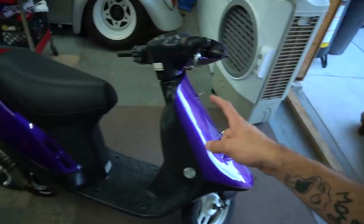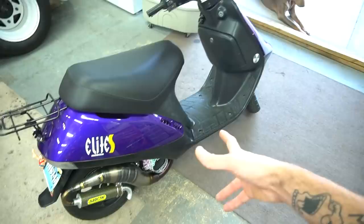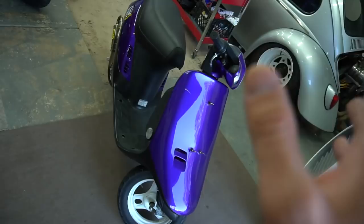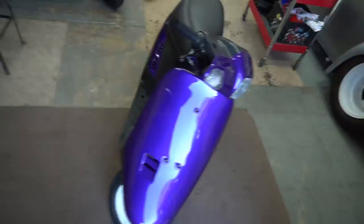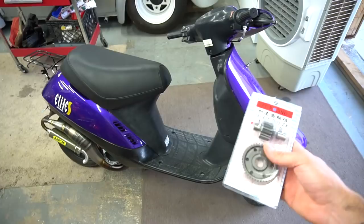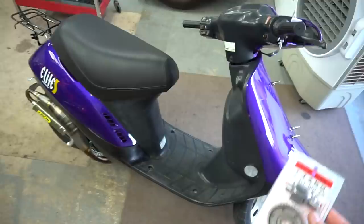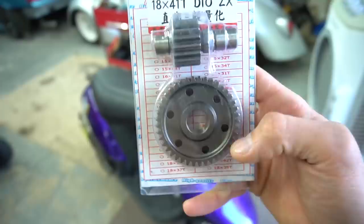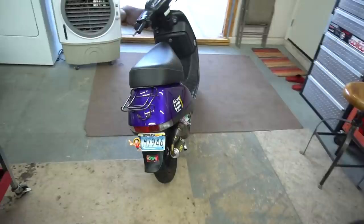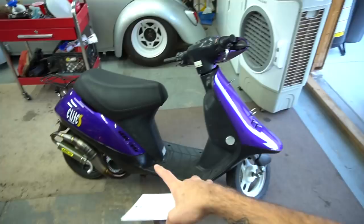Jumping right back into the Purple Bike. We're taking a step back — you guys saw how when I built it I changed the gears to 9-1 gearing with the 72 kit. The reason I was doing that originally was because I wanted to make this the wheelie bike. But then I got the Zuma, which is more the mess-around wheelie bike. I need to get more top speed out of this thing so I can hang with Chuck and Cole when we're mobbing — they're going like 60 plus. This thing's topped out because I got 9-1 gears in it, so we're going back into the gearbox to swap out the gears. It was topping out around 50-55 miles per hour and just screaming — too low of gears.